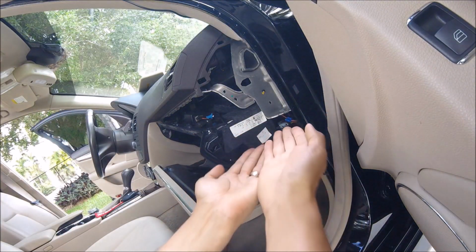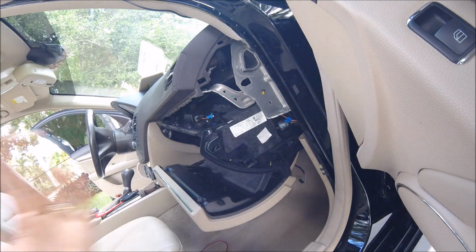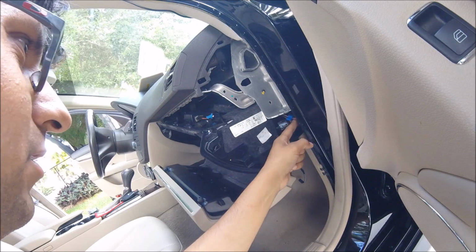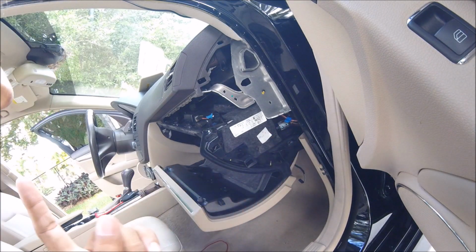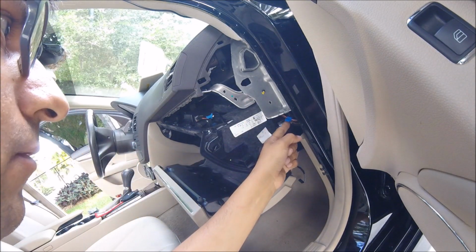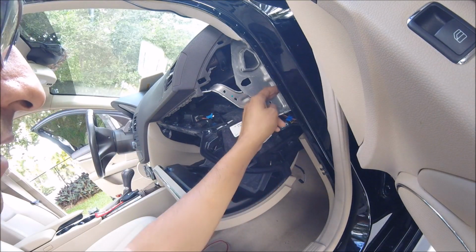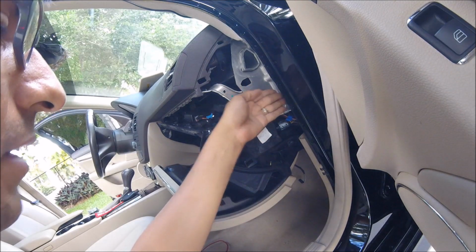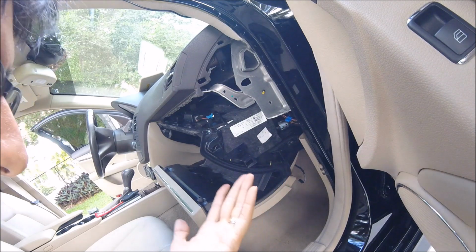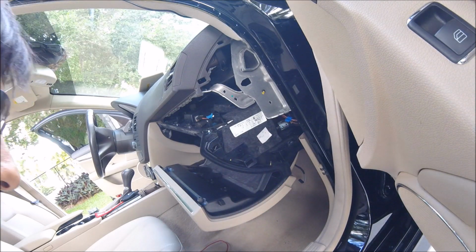So there we go, our spade connection's on. I know what you guys are thinking, Raymond, why didn't you put a spade connection on the brown since you have to ground it? One simple reason. Why do I want to go through the aggravation of doing this again? Just back this up a centimeter and I can ground right to this metal plate. So there's no sense in me using 2 spade connections when I really don't have to.